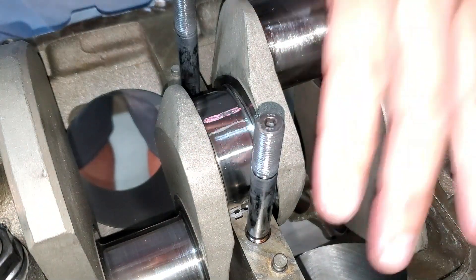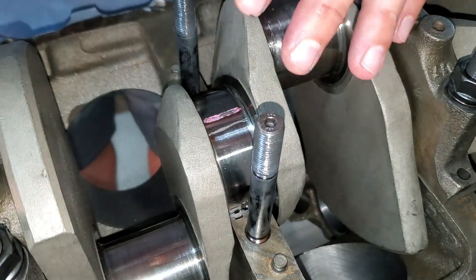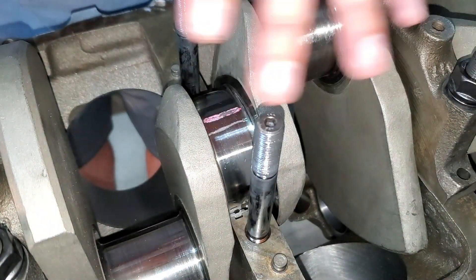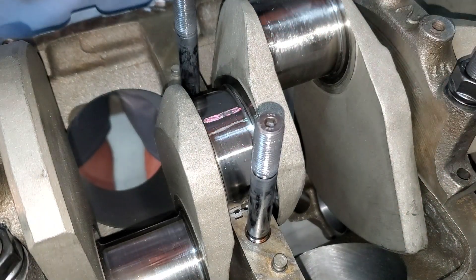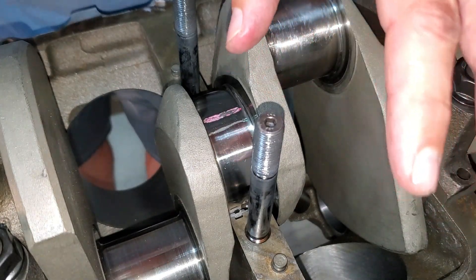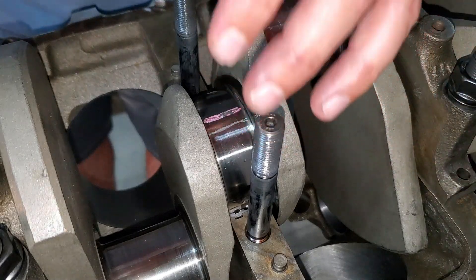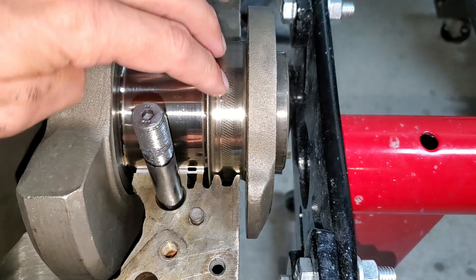Now I'm going to tear this apart — this is your last chance to clean anything in the engine. I'm going to clean up all the oil I put down, probably brake cleaner with a lint-free cloth everywhere. The next step is putting the crank in, but I'm actually going to put the cam in first. It's easier to do the cam with the crank out because you can hand-hold the cam, and then I'll put the crank in.